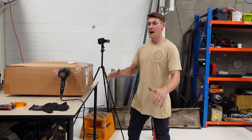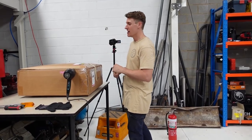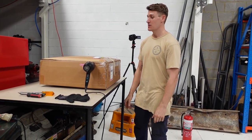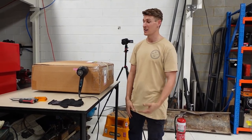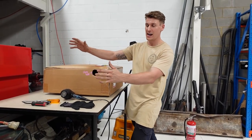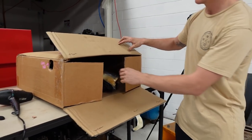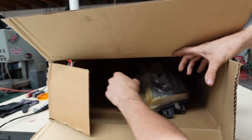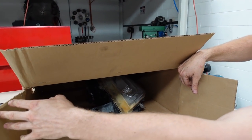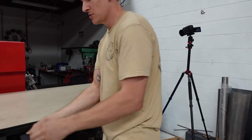It's been about 30 to 45 minutes. It's getting really warm inside the box — actually quite hot — so hopefully it's started to pull away from the adhesive on the lens cover. We had to swap over to the hair dryer because the other one was battery-operated and it ran out of batteries. I've got flat-bladed screwdrivers and pry bars ready, and a pair of gloves because the adhesive is going to be really hot. I just made sure the hot air wasn't directed straight onto the lens or any of the electrical cables. If you're using your partner's expensive hair dryer for this process, I'd recommend not pointing it directly on the lens.